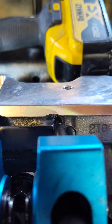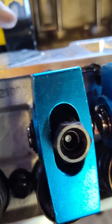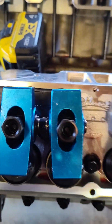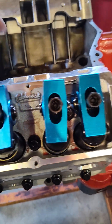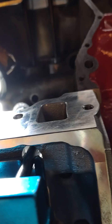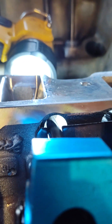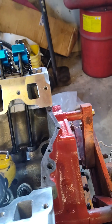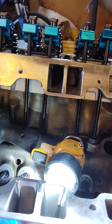It's not as close as it looks on this one here. I had to actually file a little bit on the heads because the push rods were so close — both of them were so close to the outer edges. The holes are just not quite in the right place, and I think it's Edelbrock's doing. I had to elongate the holes in the guide plates a little bit so I could shift them over one way or the other.